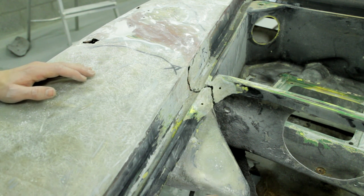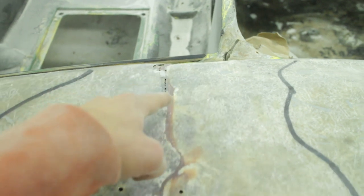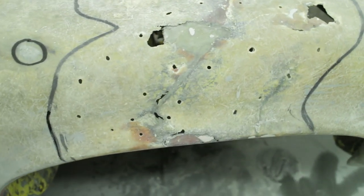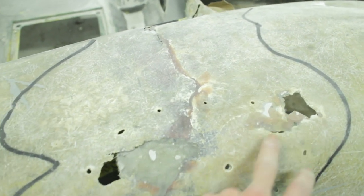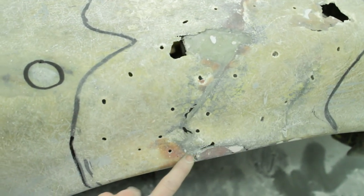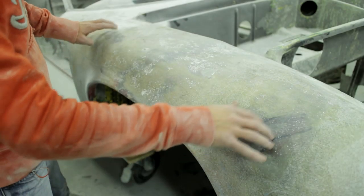Once we're doing this we're going to do the underside of the headlamp pockets. From underneath I've uncovered the ugly repair on the front wing. Now we can clearly see the crack along the wing with all the holes for the reinforcement plate that I removed. I've ground back to sound fiberglass. There are some small repairs I'll leave for now, but I'll remove them from underneath and fill these small holes with a bit of tape just to make sure the fiberglass doesn't drop in.